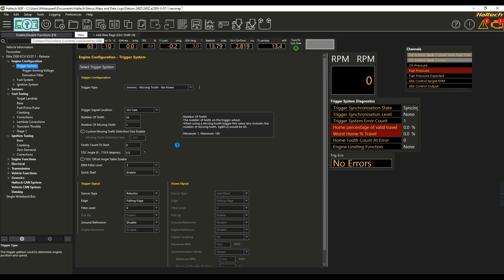I'm connected to the ECU — you can see it's showing green. Right now I have the RPM set to zero, but as I turn up the dial on the auto signal generator to start generating pulses, you'll see the RPM start to display on screen. I'm adjusting the knob off camera, and you can see I can increase and decrease the RPM at will. There are no trigger errors coming up — it does count one briefly but it's not a repeated error, so nothing to worry about. The main trigger errors screen shows no errors. It's successfully detecting the input and displaying the correct RPM.